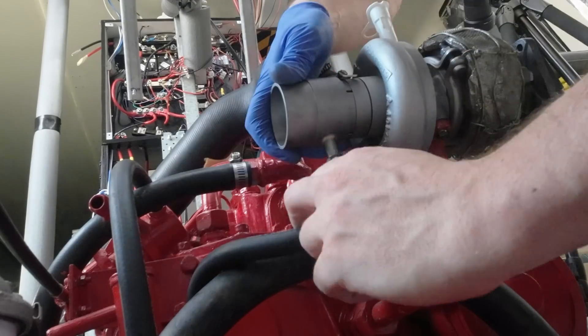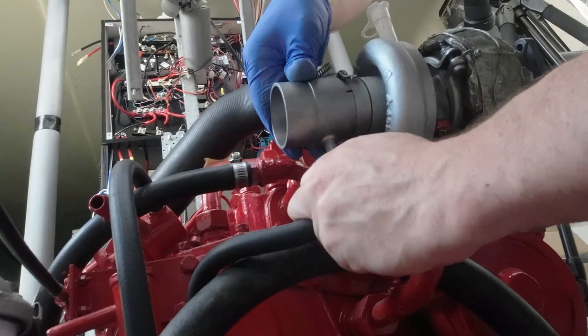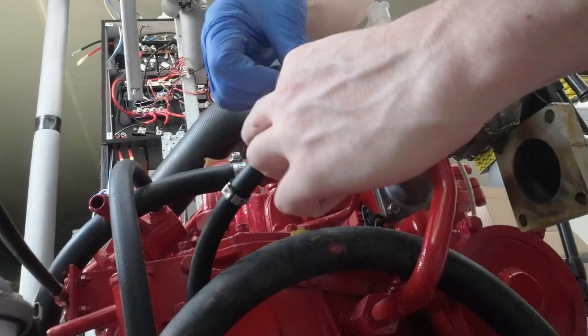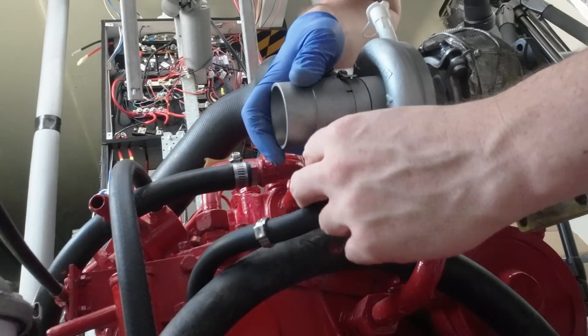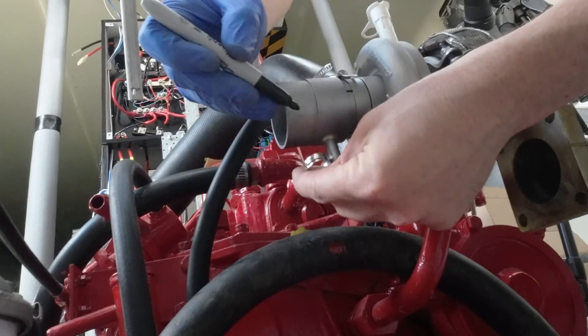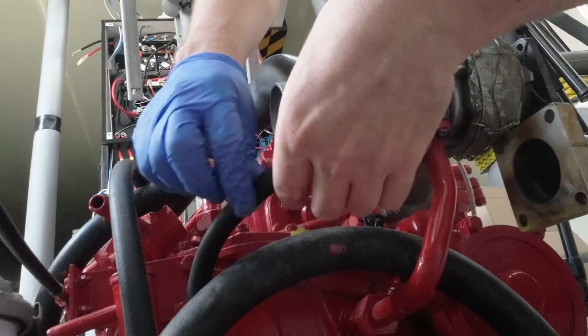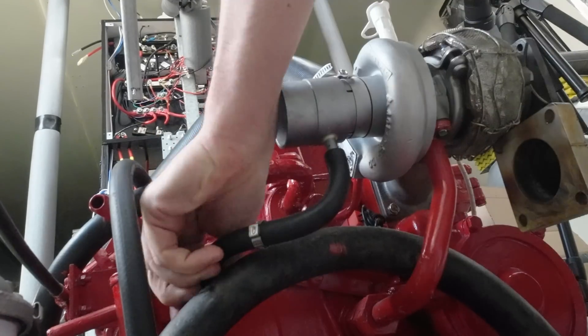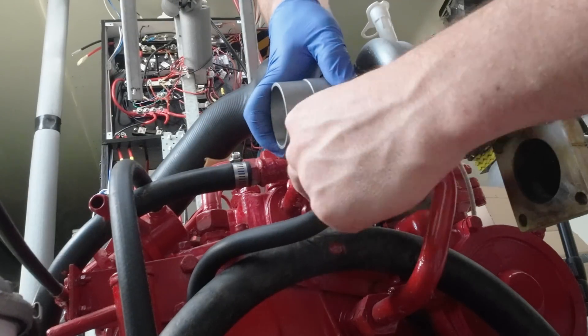These inconsistencies in gauge are rife on this engine, turbo, and cooling circuit system. I only managed to get it on half as far as I wanted, but far enough on to get an O-ring to close. It only transports air, so I'll see how I feel before deciding to replace it again or leaving it. The hose still touches the other hose — I've used Kevlar tape elsewhere to protect hoses from chafing, and you'll see that in the cooling hose video.